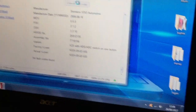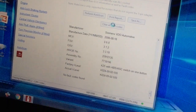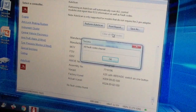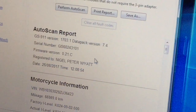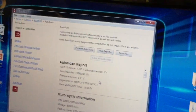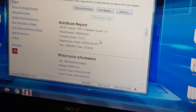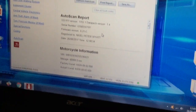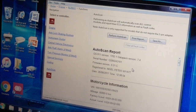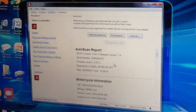If I went to BMW to get it sorted it would probably cost me a lot of money to have them all cleared. It says all four codes cleared now. What you do have to do is cycle the ignition — that means just turn it off, wait 10 seconds or so, and turn it back on. That recycles the ignition and resets everything, so whatever you've put in there will reset on your bike.